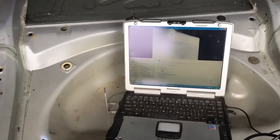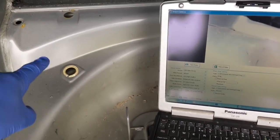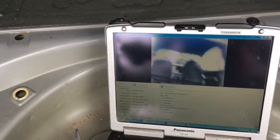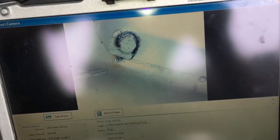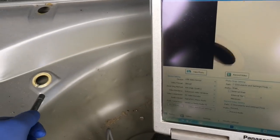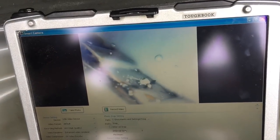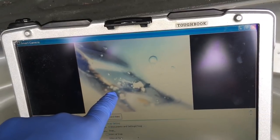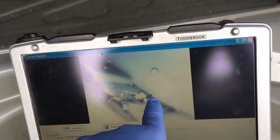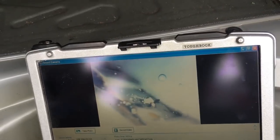We're inside the boot now. The small damages we found on the rear axle carrier panel internal sections are underneath the boot floor panel. Going through these factory grommet holes using a borescope camera, we can see a broken spot weld in this top left corner — identified by that black ring — and a small crack nearly all the way around the circumference of the spot weld. Then going through the lower cavity panel, we've got very early signs of a spot weld breakage and a crack, with a black line identifying the crack up to the edge of the panel, and then the crack going across towards a vertical section — it's just started going from horizontal to vertical and is going to be starting to climb up shortly.